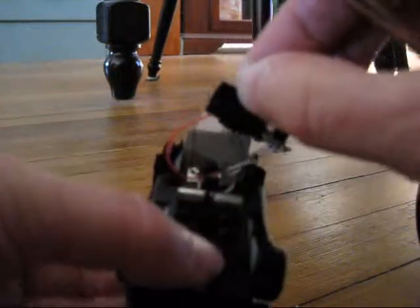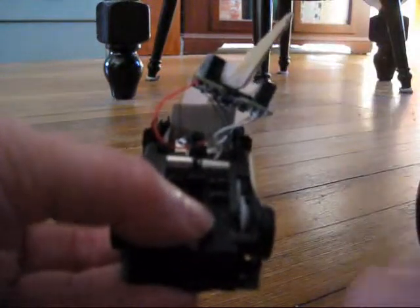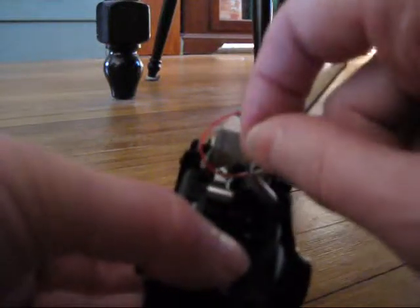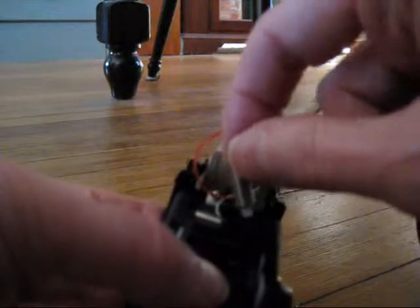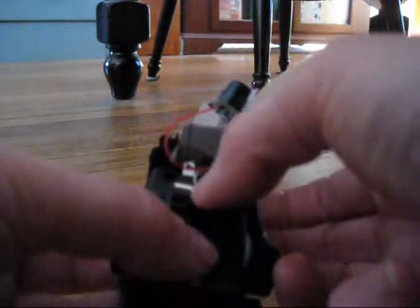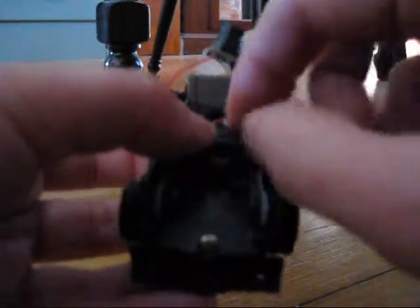This little cover comes off right here with a flat screwdriver. I've already switched these two motors — they just pop out. I'll show you if I can do this gently; they just come right out. Be very careful not to disturb the wires. You can just take them out, switch them, and pop them right back in. Nothing else gets connected; they just sit in there. Put the cover back on after you switch them, making sure not to pinch the wires.